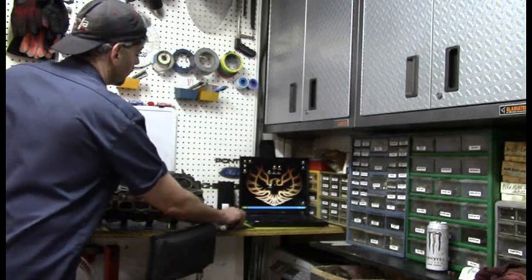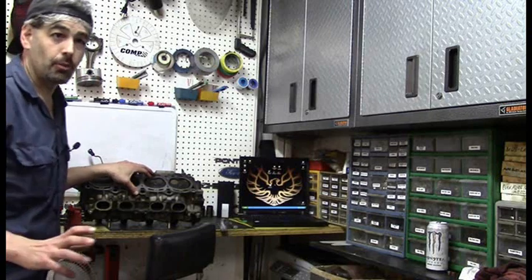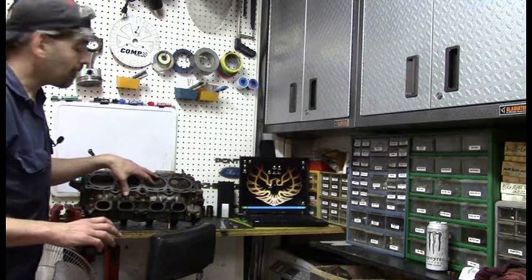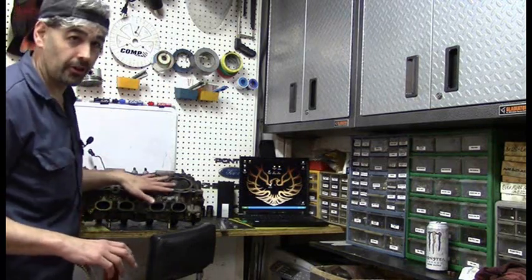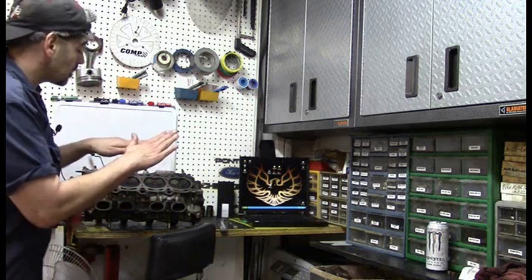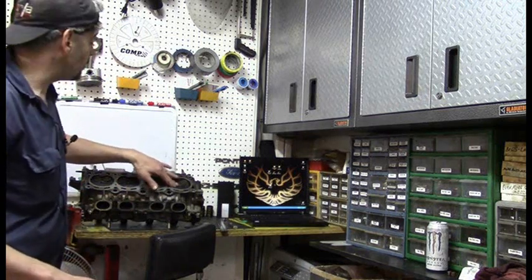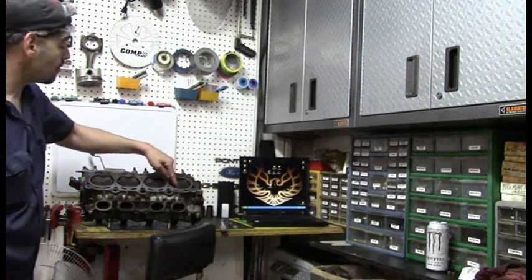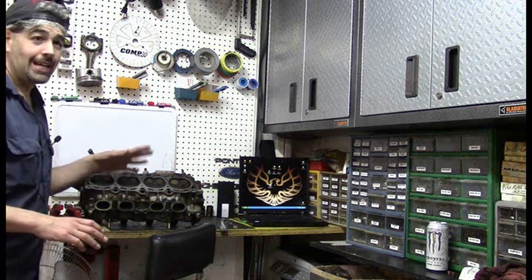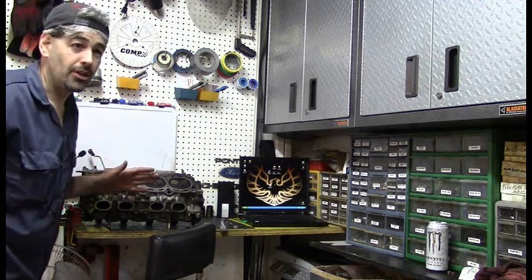Here's what our options are. Because of the budget, we're actually going to replace with a used cylinder head. That's always an option, but you would normally take this to a machine shop and have them resurface the cylinder head to make it perfectly flat. Keep in mind that doing that is going to lower the surface of the cylinder head, and you may not actually be able to do that — particularly if you've got a lot of warp — because now the valves are going to open closer to the piston. The bottom line is you don't take the cylinder head and just put it on with a new gasket.